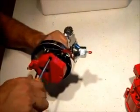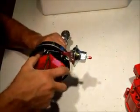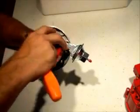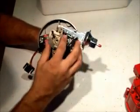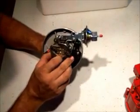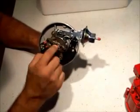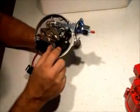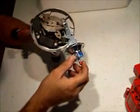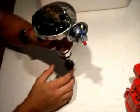This is just a General Motors HEI distributor. The rotor, cap, everything out of an eight-cylinder HEI fits right in this. We got the advance weights here — I can buy an HEI advance curve kit if I want to, and this has already got a curve kit in it. I can play around with the timing advance. Here is just a regular General Motors HEI control module, and you got the vacuum advance here. So basically from here up, it's all Chevrolet HEI; from here down, it's all Ford.